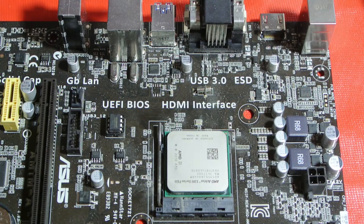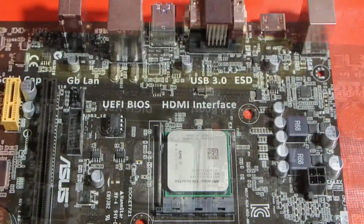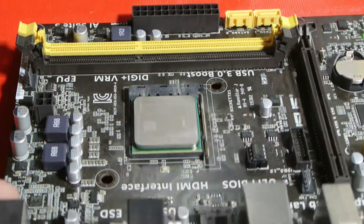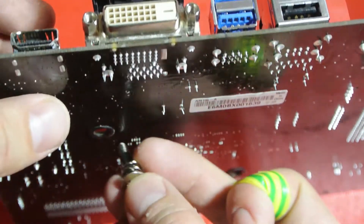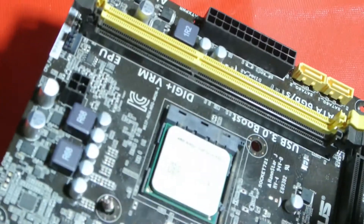I am doing a sort of i5/i7 build at the beginning of next year, so we will cover how to do a lot of things with thermal paste installing and stuff - everyone's got their own little way. As you can see, this cooler has got its own thermal paste. Now the AM1 platform on these motherboards - they don't have a back plate, which makes it quite tricky to get the fan installed in one go. There are two included sticker washers that you stick on. The method I'm going for is to do one screw first, get it sort of fixed, and then line the other one up.